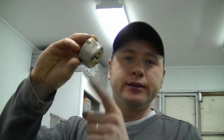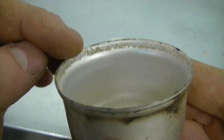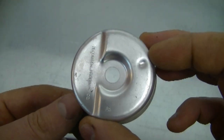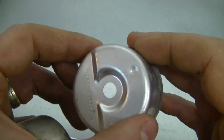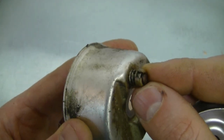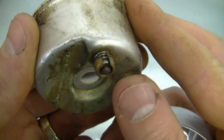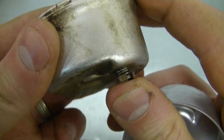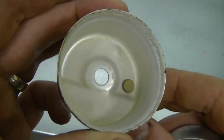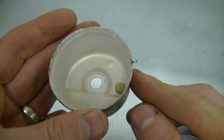The next question is about the drain valve on Tecumseh carburetors found on some snowblower engines. People ask what to do when the little valve starts to leak. You can buy just a valve kit, but often when it's time to replace the valve it's also time to replace the bowl, especially if it's corroded. I usually replace it with a bowl that doesn't have the valve, since these little valves can leak even when new. The valve's purpose is so that at the end of the season you push it and drain the fuel, preventing fuel from going bad and dirtying the carburetor.